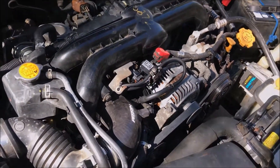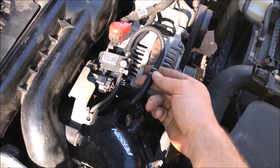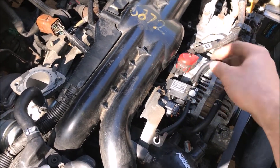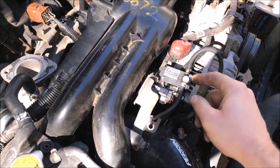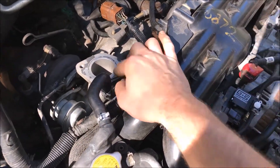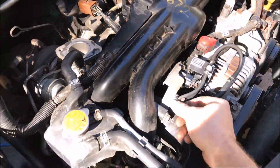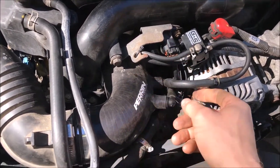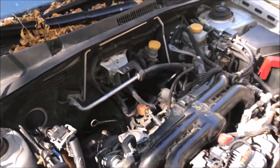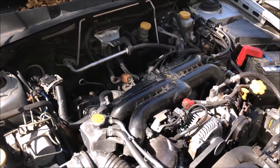To recap: port one goes to the intake — I used the factory hose for that with a zip tie, fusing it with the factory portion that was going back to the turbo, and a zip tie to tighten it up. This is the vacuum return side, so not much pressure and no clamp needed. Port three is a pressure hose going to the compressor housing nipple. Port two is also a pressure hose with a clamp going to the wastegate nipple. Hoses secured with a zip tie, firmly mounted, sensor plugged in, boost controller plugged in — and that's it. Reinstall your intercooler if you removed it. I'll put links in the description where you can get this boost controller. If this video helped you out, hit that like button; if you want more videos like this, hit subscribe. Thanks for watching.